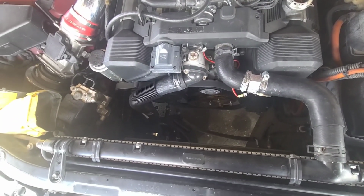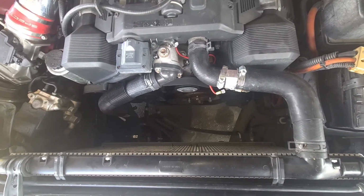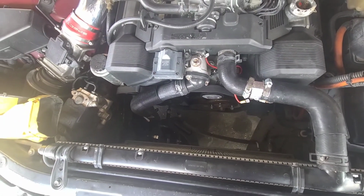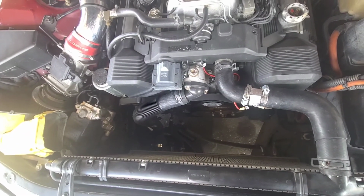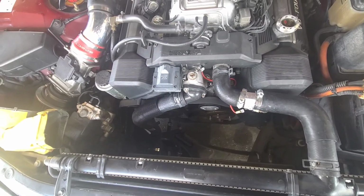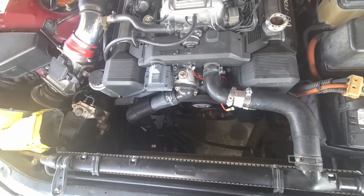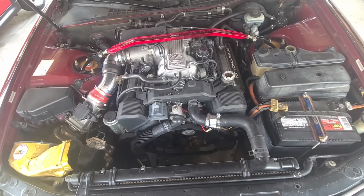I'm going to grab my other oil pan, so when I undo the transmission cooling lines down there, I'm going to be able to let them lay in the drain pan with the oil coming out, so that will catch it and not make a mess. And then we'll go ahead and remove the radiator to give us more room. After we get all that out of the way, we'll undo the belt.